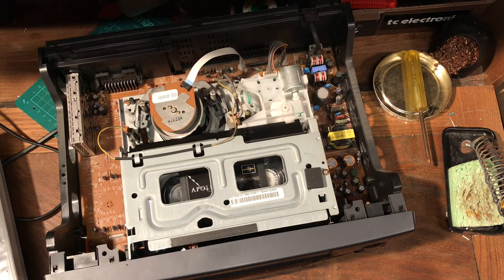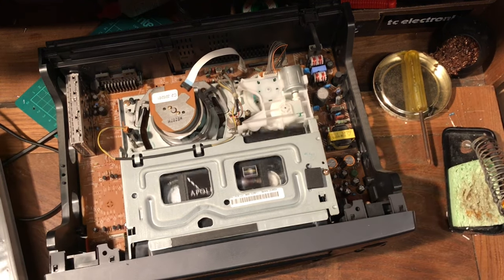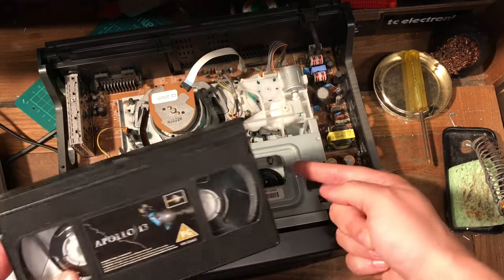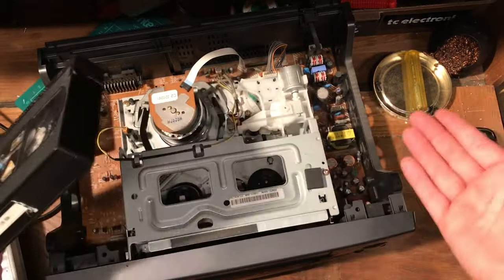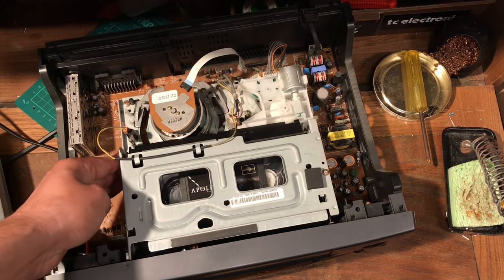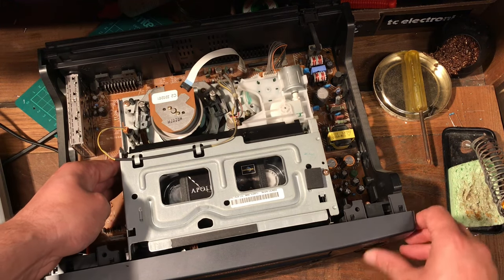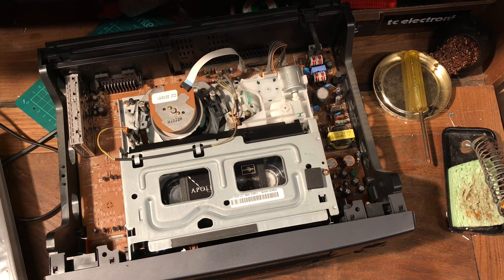Well, nothing's ever easy, is it? Because this is what happens — you put it in and two seconds later it just ejects itself. After five minutes of googling I found out that there are optical sensors in here that sense when the tape is at its beginning and at its end, and when you take the top off it messes up all the light sensors. If I cover the little light sensor that's just down here and press play — there you go, it starts working normally. But the moment I uncover this light sensor, it stops and goes through a little sequence to eject the tape.